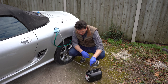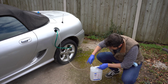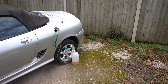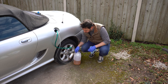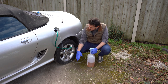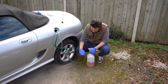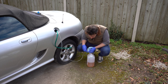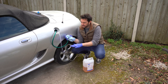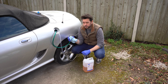It's not fast but it's working. It's stopped - for a siphon to work properly you want whatever you're filling to be lower than what you're draining from, and I'm not very low compared to where the fuel in the tank is, so maybe as the levels come down it's starting to equalise. Either that or it's running out of fuel, which would be great. That's as much as I'm going to get out, so if there is any stale fuel left in there I'm going to top it up with some fresh fuel and hopefully that will dilute it.